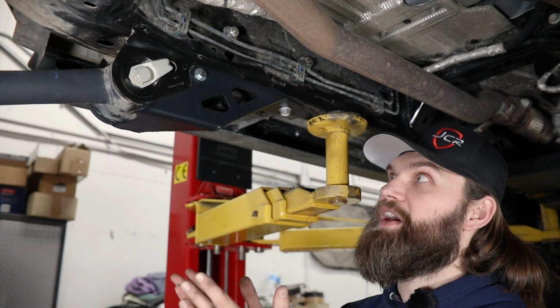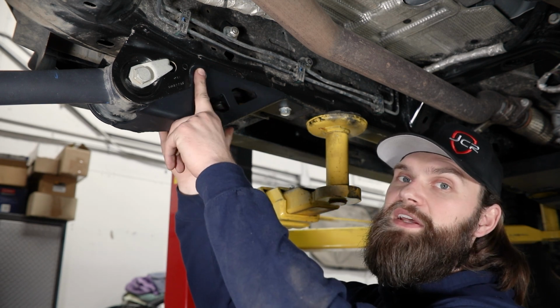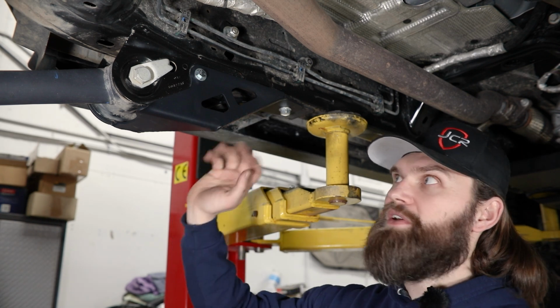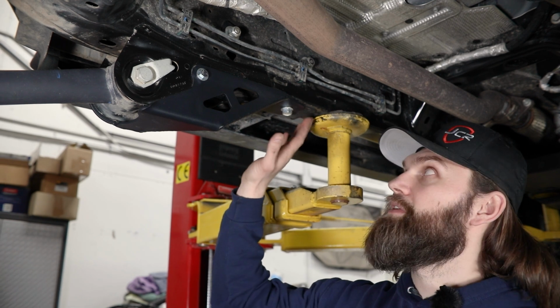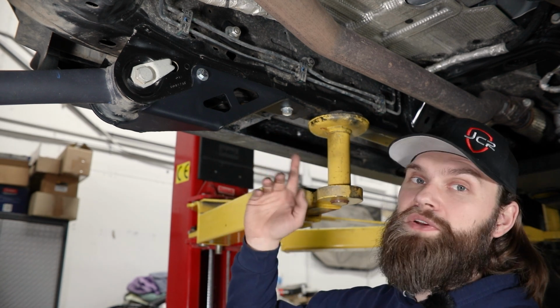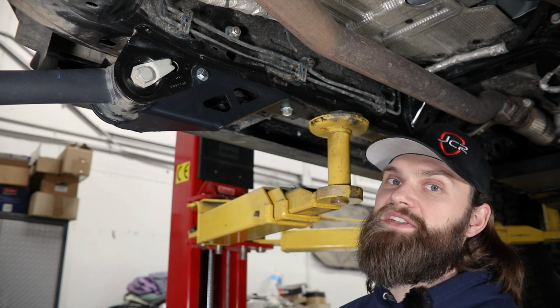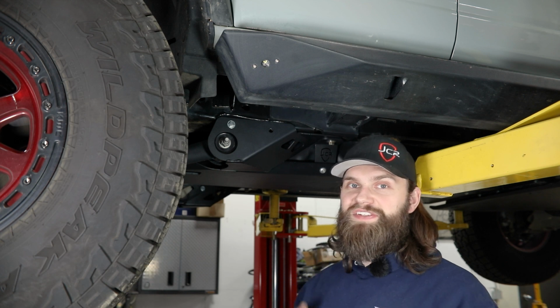Now the best way to do that is basically you'll place the skid up here on the frame, you'll install both the inside and outside 3/8 fasteners, and that'll kind of locate the skid. You can even kind of lightly snug them up. Just make sure that this is pushed up tight to the frame at that time. And then using the skid as a guide, you can center punch and drill that hole out to 7/16 to accept that 1/2" self-tapper. Now at this point, your installation is complete.